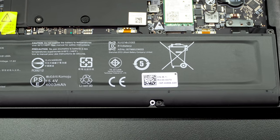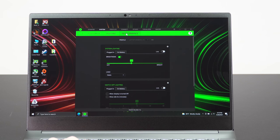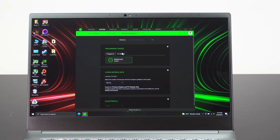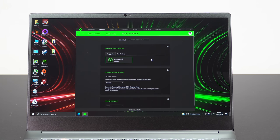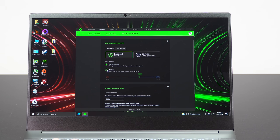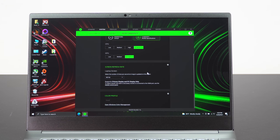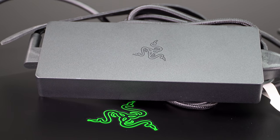Battery life — there's no big battery in here either. The giant vapor chamber took space away from battery capacity: 61.6 watt-hours. Comparing that to the Zephyrus G14's 76 Wh or the G15's 90 Wh battery, plus you've got powerful hardware inside, we were getting about seven to eight hours at 200 nits doing light productivity and streaming. Push it harder with something like Adobe Premiere and you'll get shorter runtimes. It comes with a 230-watt power supply, more than adequate, so the battery shouldn't discharge while plugged in.